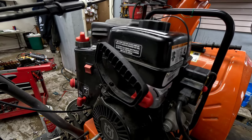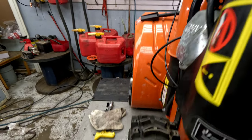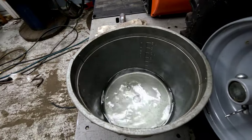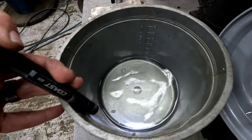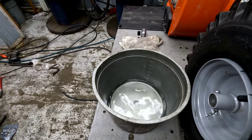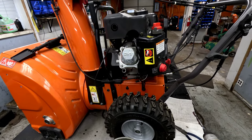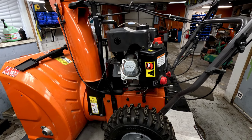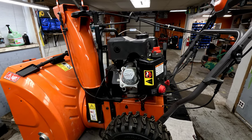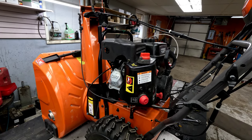It looks like all we had here was the carburetor with some water in the bottom of it — it was gummed up a little bit. The fuel didn't look horrible, but there was some kind of gunk in the bottom and some water. Maybe not that high quality of fuel. That caused this whole thing to start and run erratically or not start at all — very common on these engines. It doesn't take a whole lot for them to have this issue. That should get you going and give you at least some guidance on what's going on no matter what's wrong with your LCT PWHK 1650. Thanks for watching — like and subscribe.